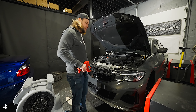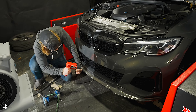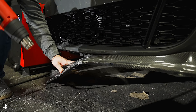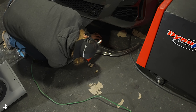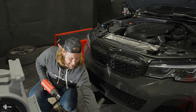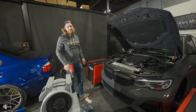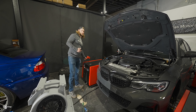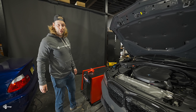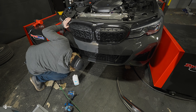What you almost saw when we filmed it the first time without audio — I started to remove the front lip and basically just took out all of the screws, which are in a little pile over here on our dyno. Now I've grabbed our heat gun. I'm going to start to heat it up and press the lip off the bumper. By heating it, you're going to give your 3M tape a little flex and it's going to come off a thousand times easier. It's about 50 degrees in here right now, so a little chilly, but I think this should be pretty easy.